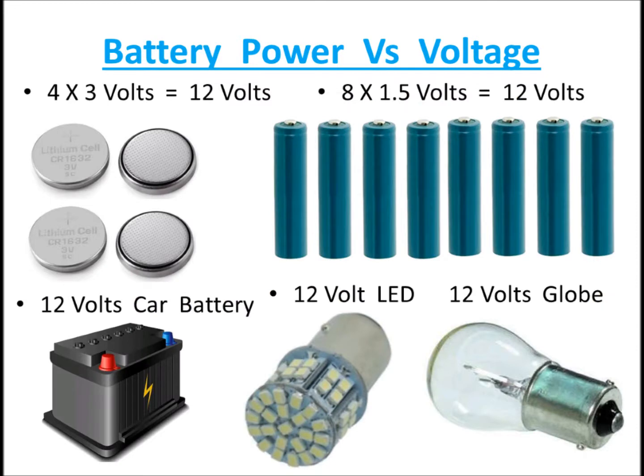Just keep in mind that with some cameras, you may need to get a CAN filter, which is basically like a relay, because a lot of these cameras need power from your reversing lights. A lot of cars, especially the newer cars of the last 10, 20 years or so, have low powered lighting, therefore they don't necessarily have enough power, not the voltage, but power behind the light, to power both the light bulb or LED in your reversing light, as well as a camera.